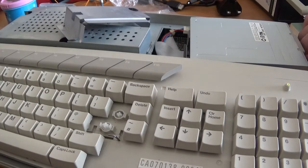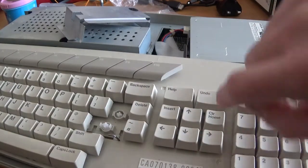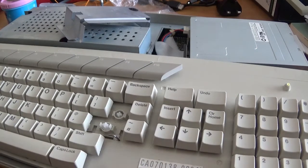So I'm thinking once that's done, the joystick port, which is another, if you don't know, the 2 joystick ports, which were effectively a design failure of the STs anyway, seated underneath the case. They're notorious for breaking, just down to the angle at which you have to plug the mouse and the joysticks in. So what happens is the D9 pin connection solder can break on certain pins. More often than not, eventually they will have to be replaced. On mine at the moment, they're both working, so that doesn't need to be done. And apart from that, there's nothing. It should be good to go then, and I'm hoping a lot of my software that I have got will load up then.